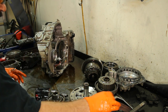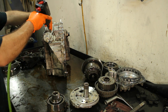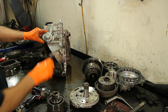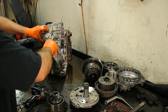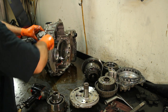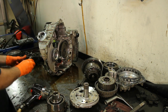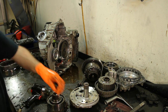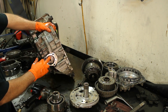Let's go ahead and take this cover off before we end the video. This is just the cover, and then it has a snap ring on the servo. The band can be adjusted, but why try that? You're just going to cause more problems down the road — it'll probably work maybe one or two weeks. There's a gasket and an o-ring down here, and it looks like it's never been removed before. Keep those three bolts together. Here we see a snap ring that holds our servo piston in there.